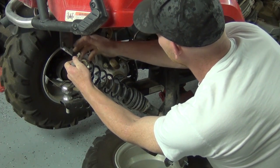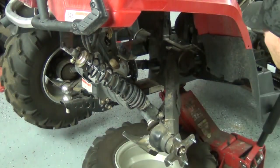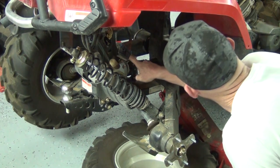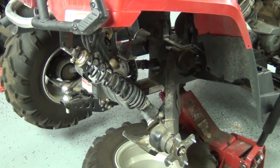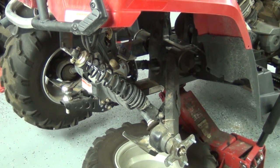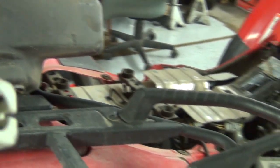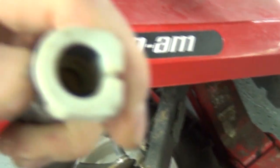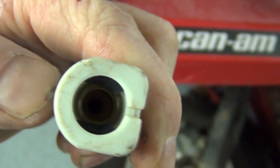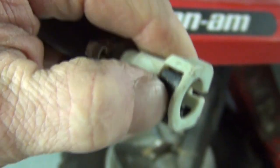Now you've got all the access in the world. Pull your tank out - there's a bolt here, a bolt here, another one up here, and then a couple on the other side that you have to pull out. This is the front of the tank and you'll see these hoses. The end of this hose is a quick disconnect - you just have to push in the collar. When you push that in, it opens up to let go.